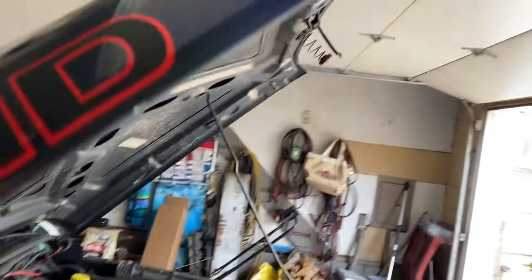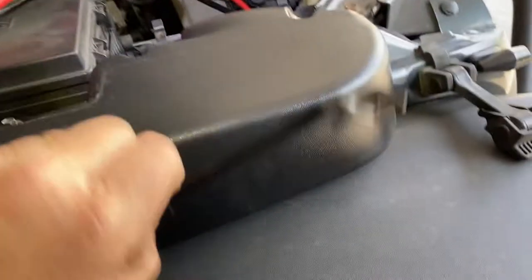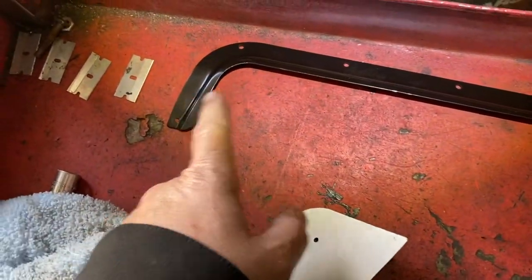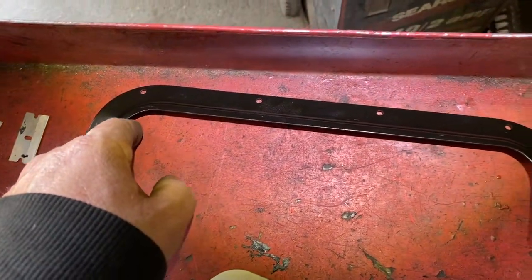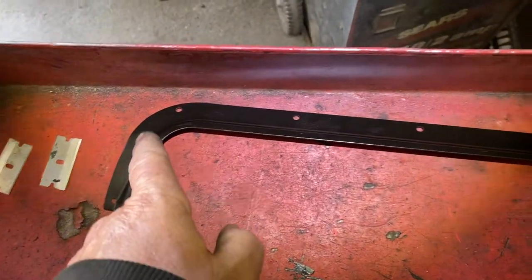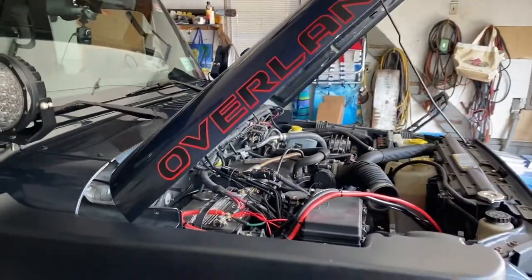Once you close the hood you can transfer that mark to wherever it needs to go. What you do is trim on the inside. A lot of guys follow the instructions — you can't blame them — but the instructions are wrong. They'll cut out the hole and it's a little too big, and when they try to put the trim piece in, some grab and some don't. What you do is mark around the outside edge and cut over the line — leave the line, don't go inside — so when you cut you have plenty of meat to get your rivets in and everything is perfectly aligned on the hood.